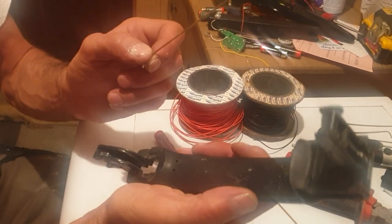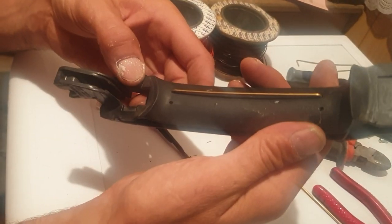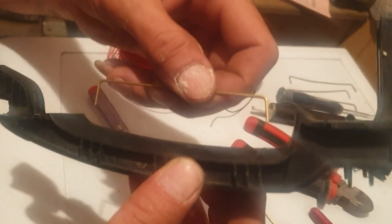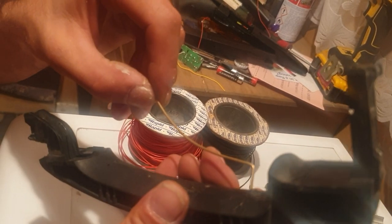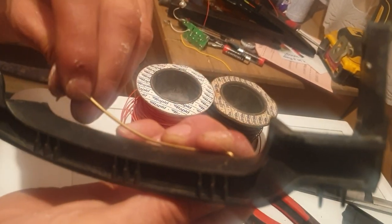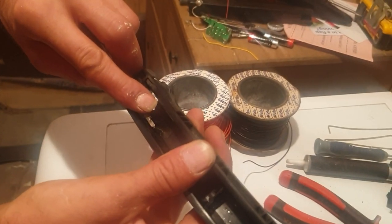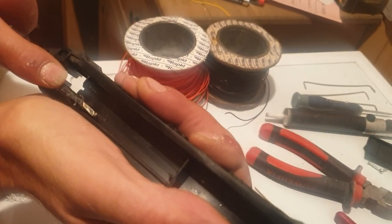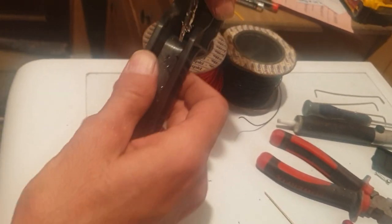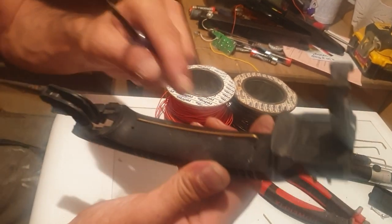You need to take the inside of your handle, push the brass rod through that hole and through that hole. Because there's a gap and this is a curved handle, take it out and bend it to more than the curve of the door handle. Then poke it back in, hold that end, and poke that end in. There's no gap when they're pushed in. So you push them in and get a screwdriver and fold those ends over — just like that. So that's folded over, and it can't fall out. So you now have one wire.